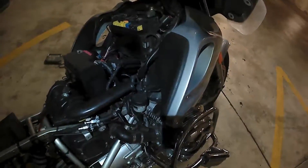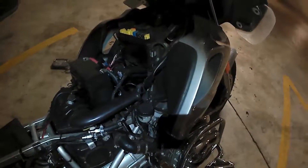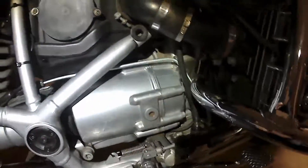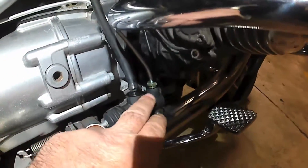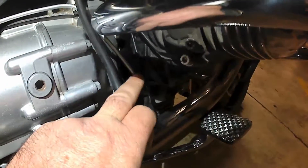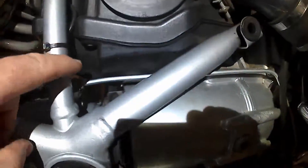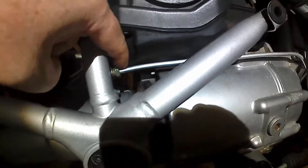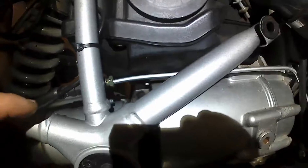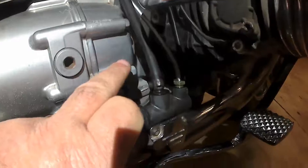About the transformation regarding the braking line, it's a very easy path. From the rear circuit, we have the pump here, and it was a line from here to the ABS unit, and another line from the ABS unit to the rear wheel circuit. I just need to make this brake line here.